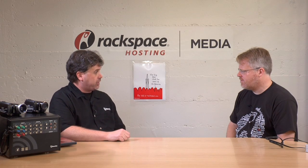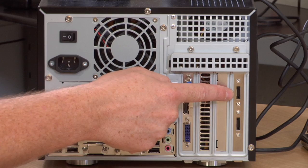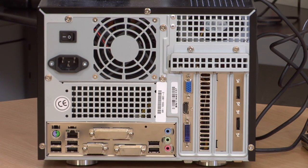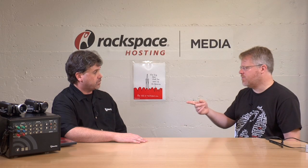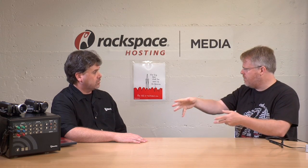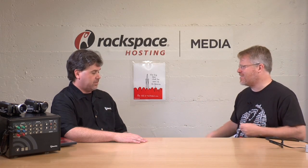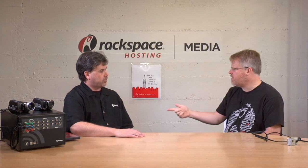There's a hard drive in here — how big is it? The hard drive is a terabyte, partitioned into two: one for the system and one for the media drive. You can get about 20 hours of high-def on the TriCaster out of the box. There are also two eSATA ports on the back allowing you to hook up eSATA external storage and expand as much as you want. We're also talking to Drobo this week — you can hook up through eSATA for terabytes and terabytes of high-speed video storage. There are also USB 2 ports on the back.